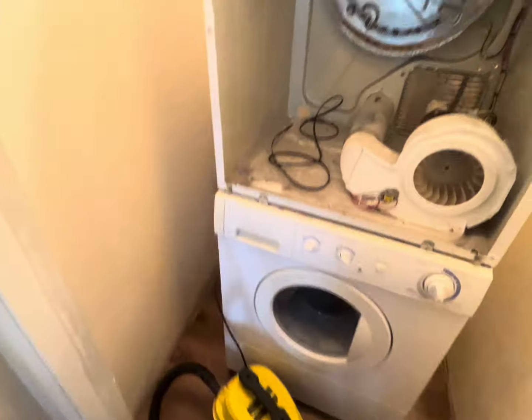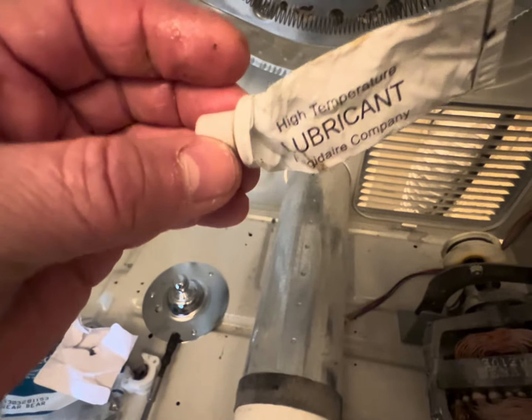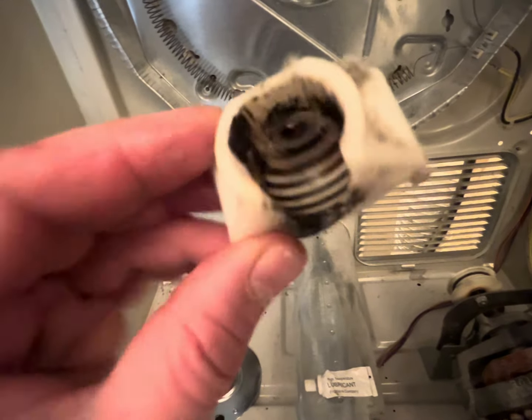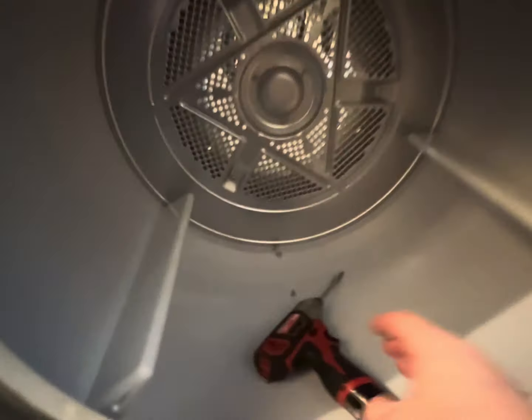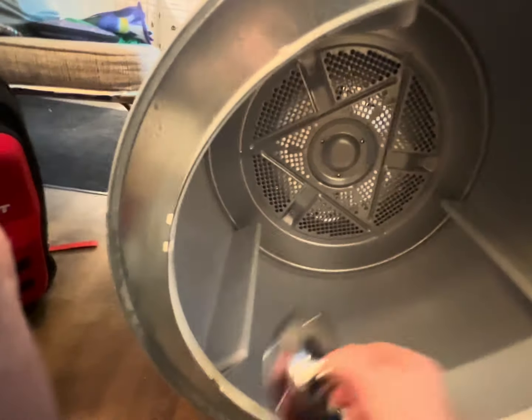I proceed to step-by-step repair. The first stage is cleaning the dryer from lint. Then dismantling the faulty parts and installing new ones in their place. Having installed a new plastic bushing, I fill it with a special lubricant that promotes long-term rotation of the metal part that is attached to the drum, without damaging both rubbing parts. The faulty parts were removed and new ones were installed.